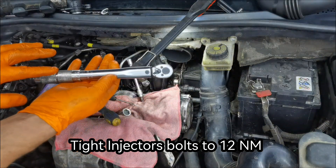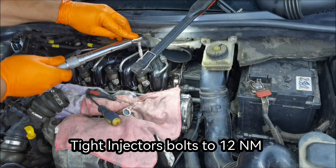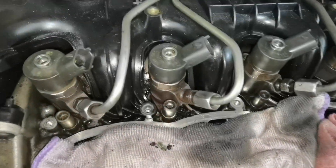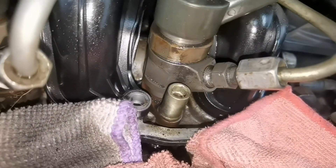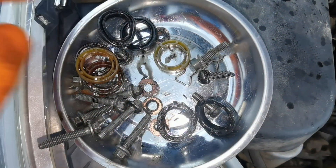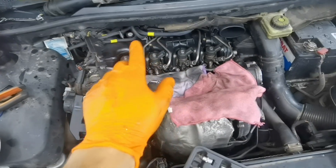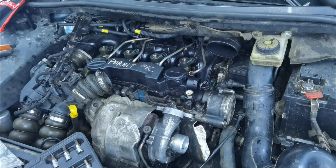It's exactly the same process for the other injectors. I'm not going to film the other injectors because this video will be too long — I will do them off camera and then come back and show you how to install everything back as it was before. I installed all the new washers onto the injectors and replaced all the o-rings. I cleaned the area around the injectors very well. These are the old o-rings from all of the injectors — they are in very bad condition and I think they have not been replaced for over 50,000 km. Now let's go ahead and put everything back together, including replacing the o-rings on the plastic fuel pipes.